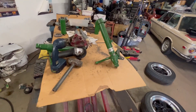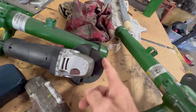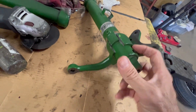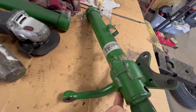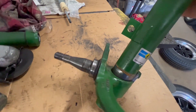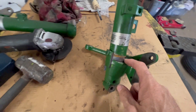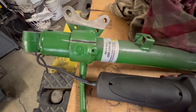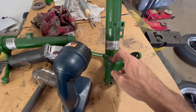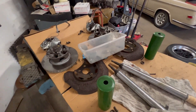What needs to happen is the spindles need to be dropped on the strut. I grabbed the grinder with the cutting wheel, cut here and here, and I need to move it down more and clean up all around and have it welded. It kind of sucked to hack up literally brand new struts - these are a few months old - but it is what it is. I already got one side cut; I need to cut the other side, move them down, clean up all the weld spots, and get them welded. I already got them all apart as you can see.